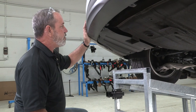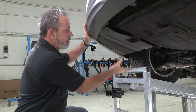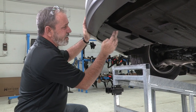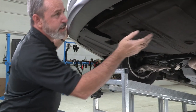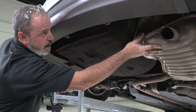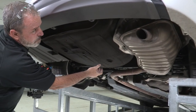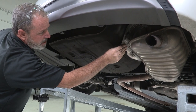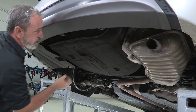So we're under the vehicle on the driver's side. If your vehicle is equipped with the underbody paneling, we'll need to drop that down and trim it just a little bit on the edge here. We're also going to be lowering the exhaust here. We'll strap the exhaust up with a ratchet strap, and then we're going to remove the heat shield, and that'll give us access to the frame there.